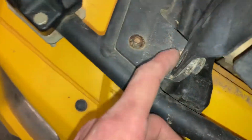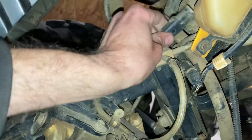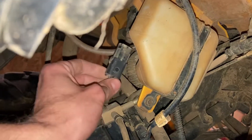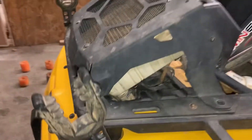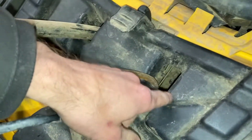You need a half-inch or 13-millimeter socket to get all these different bolts out right here for the radiator guard. There's also a wiring harness right here that goes down — come to the bottom side — and it'll plug into a plug right here by this coolant reservoir. Once you get that unplugged, you can take this right here and just pull it back out of the way, and we'll be getting into this right here.